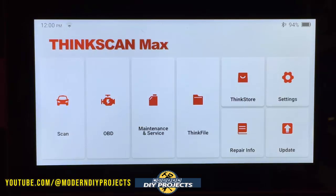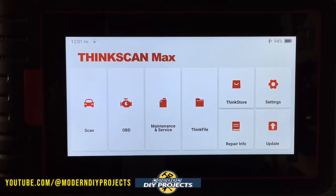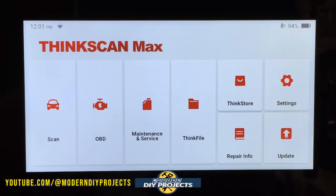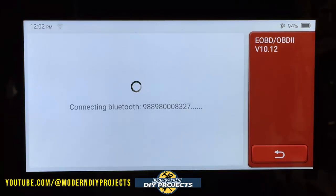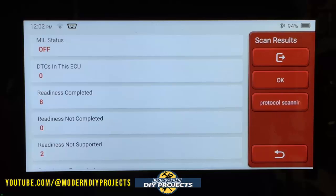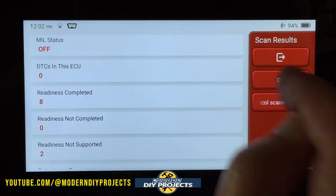Let's do a little bit of scanning on my vehicle. I already set up the OBD2 dongle, I've got the vehicle started and running in the background with the garage door open. That's the convenient thing about having a wireless scanner — the vehicle is a few feet behind me but I'm right here on my bench; I don't need to be in the vehicle. Let's go with the OBD scan. It'll hook up via Bluetooth, start going through there, find out what the vehicle is, and give you a little screen telling you everything that's going on — MIL status, all the different things that have run or not run.